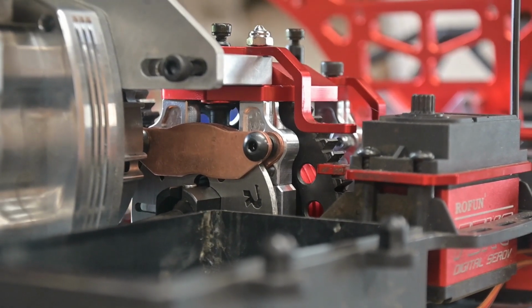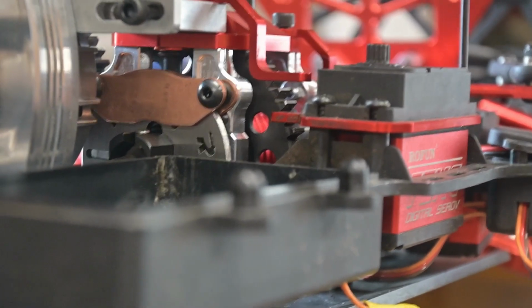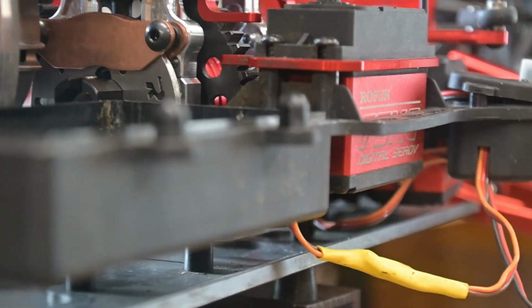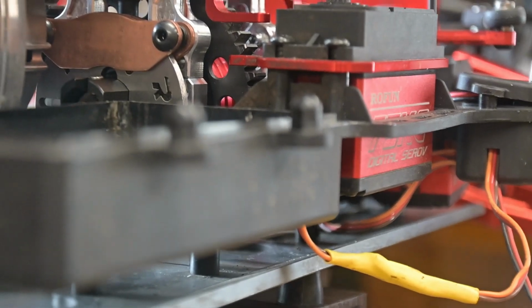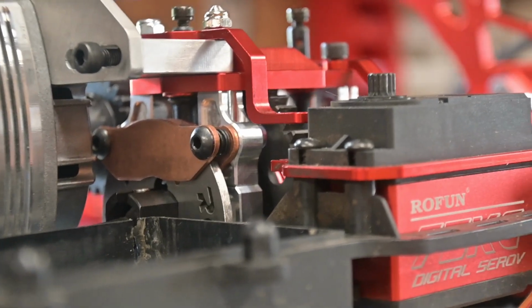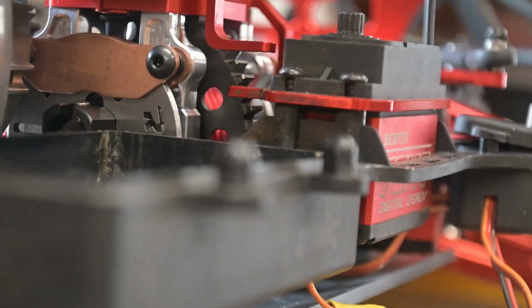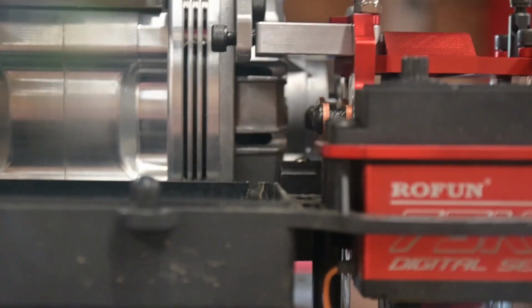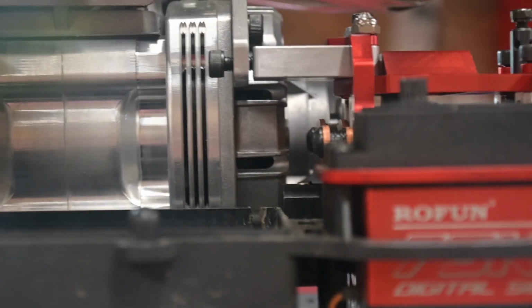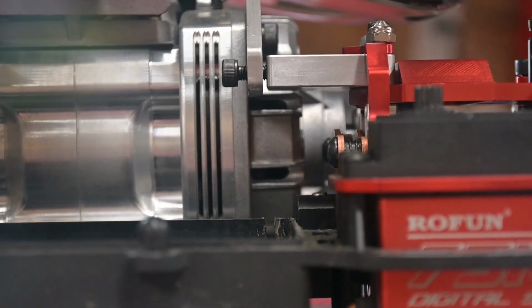So I'm getting down into the nitty gritty of putting the motor in place here. You can see the Rovan brace goes off the center differential down to the servo. That sits up on top of OBR's engine brace. So there's quite a gap in there. So I'm just going to mill a block to fit down in there. And the only other issue I got is that gap there between the engine and the center differential. I'm just going to put little brass shims in there for now.